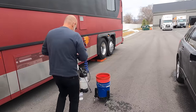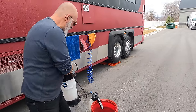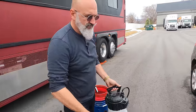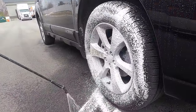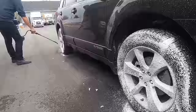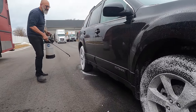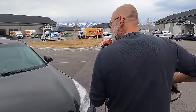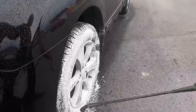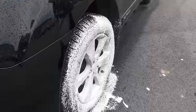We're at 4 minutes, the clock is ticking. For the wheels, we can use a foamer with some all-purpose cleaner. We'll foam the wheels. The reason I'm using a foamer as opposed to just spraying it on is the foamer is doing the agitation for me — every time one of those bubbles bursts, it's putting new APC on the surface. So that Scrubbing Bubbles commercial — they weren't lying.